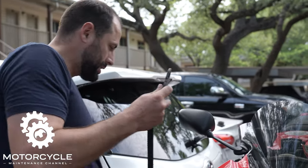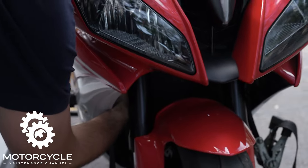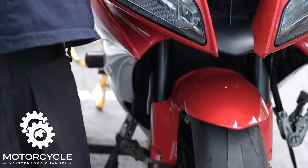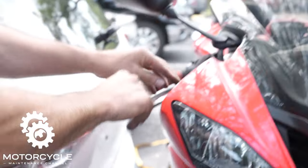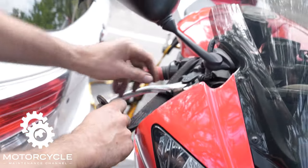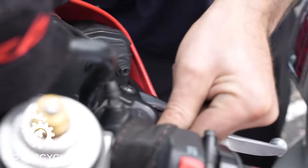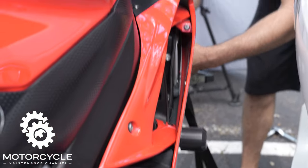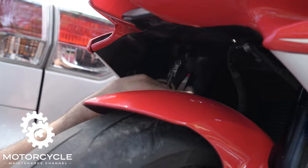All right, just like before on your clutch side, we're going to come up alongside the fork. Up this way, and we will go around this way. Now, there's a lot of stuff on the brake side. You have brake lines, throttle cables, a lot of electrical stuff. You don't want to put any pressure on any of those wires. Okay, feed it back down through here. Right there, we're going to clamp it in. Just like that. Boom.